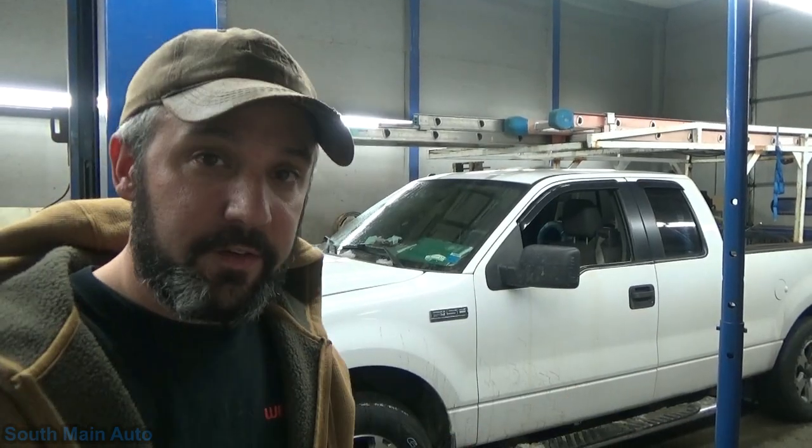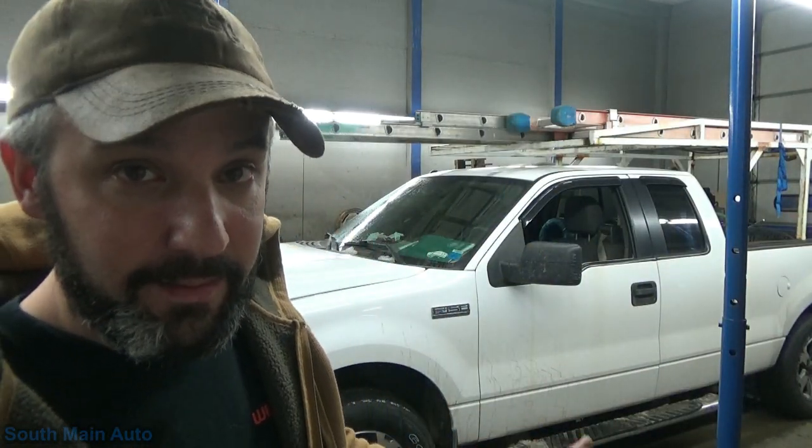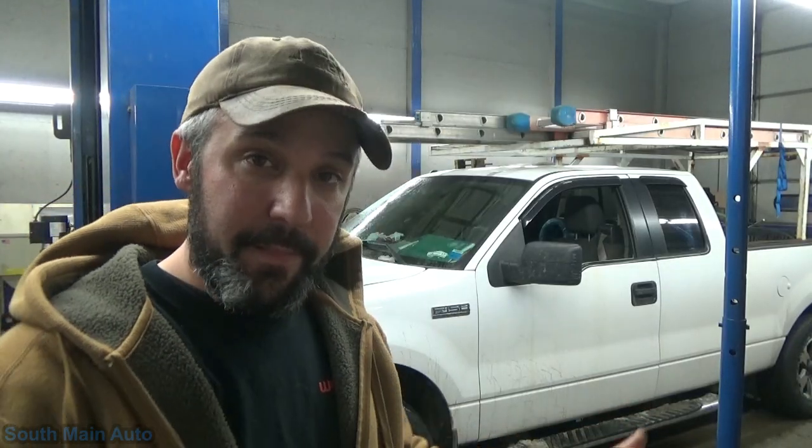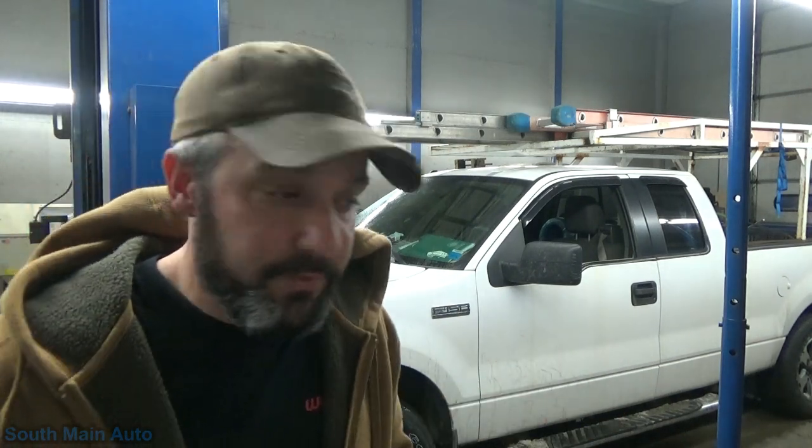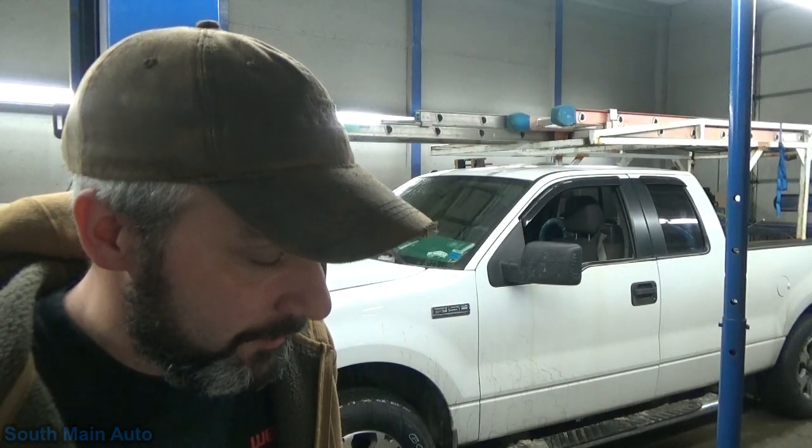Like I was saying, the ECM talks to these alternators and the alternator talks to the ECM. It's kind of, I won't say a checks and balances, but what do they call it? You've got your Gen Com line and your Gen Mon line, so your communication line and your monitor line is what they talk on. The ECM will command the alternator at a certain set voltage based on air temperature, engine load, battery voltage, electrical load, quite a few parameters it looks like, and then the alternator reports back essentially what it's doing.